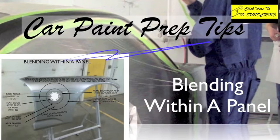You can do that wet or dry. You can use a DA, but there are a few things you've got to be very careful about whenever sanding a panel just for clear coat. You do want to get your edges really good, because remember, if the paint's going to peel, it's going to start from the edges. So make sure all the edges are good, but you've got to be very careful not to sand through. You don't want to sand through your clear coat or your paint, because if you just clear coat over that, there's no paint, there's nothing going to cover that. If you sanded through, you're going to see that through your clear coat. So you've got to be very careful not to sand through, and that's another reason I'd be very careful if I was trying 600 grit, not to sand through any edges. If you're afraid you may sand through some edges, you may use 1000 grit. That'll provide a little extra work there before you would sand through.